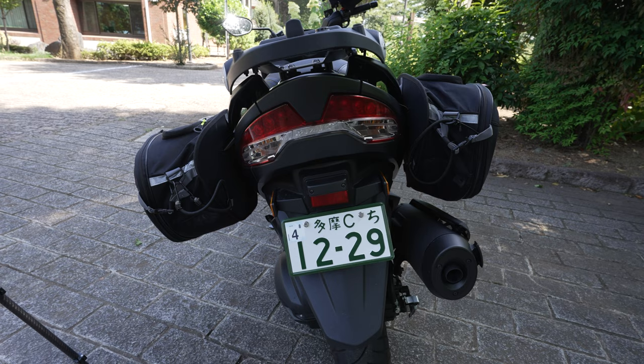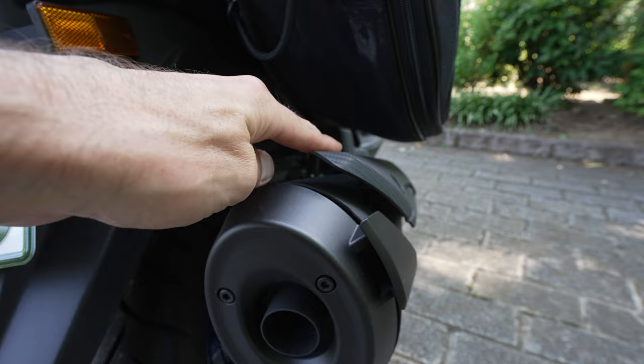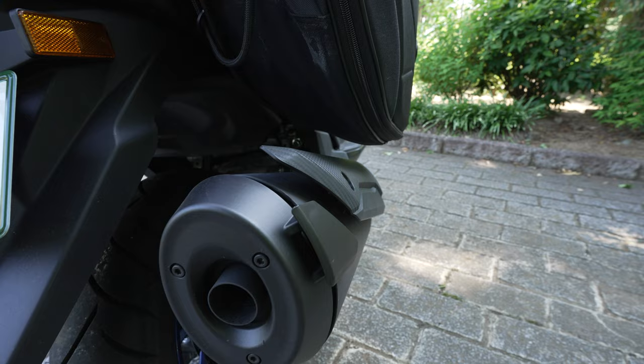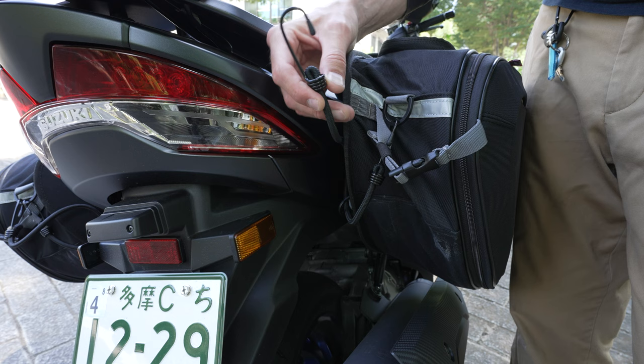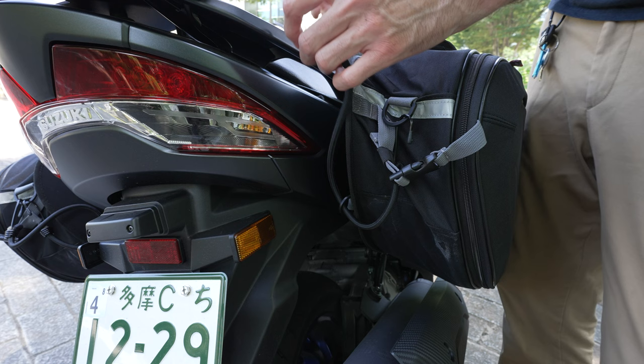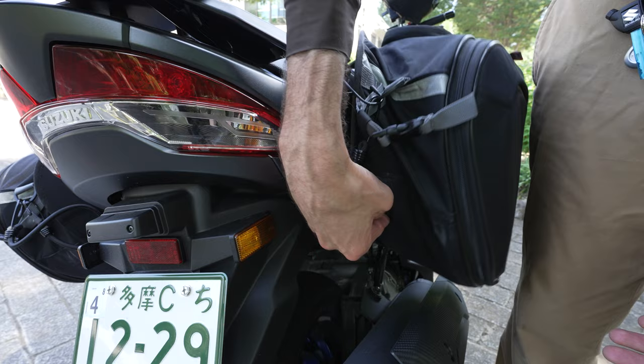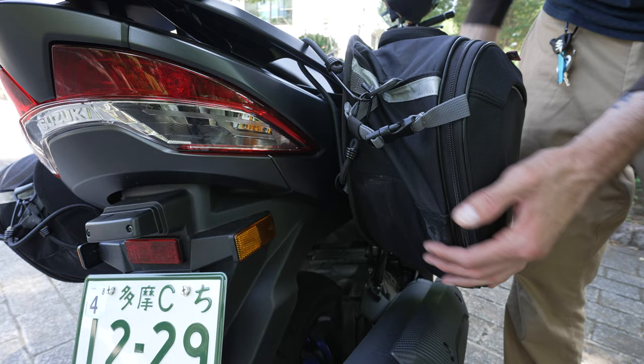The main concern I had was whether there was enough space between the muffler and the right side bag. Because there is a heat guard and actual heat from the muffler isn't coming from down there, that gives you pretty good clearance. Even when the bag is full, it leans down a little bit, but it's really not too bad. They've also given you a bungee cord - I'm not a big fan of this because it's metal and I feel like it'll end up scratching things. I've run it through the little hooks on the bag and up through here, giving you four connection points, which also holds up the back end a little bit. But be careful - the more you lift the back end, the more it can push the front end down toward the muffler.